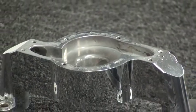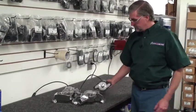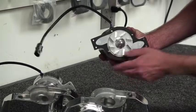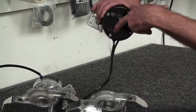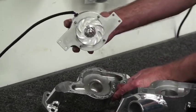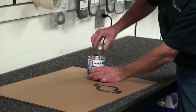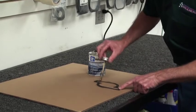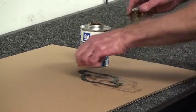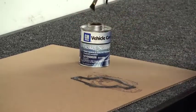Now we're ready to prep a gasket to reinstall the center section. Before we put the pump back together, we wanted to explain the differences between the high flow and standard flow versions. On a high flow pump, there's a larger impeller cavity, so there are only two assembly screws that go into the body — the other two go through the magnet housing into the front plate only. On the standard flow, all four screws go into the body. We use a GM gasket sealing compound — it comes with an applicator. Lightly tack on some gasket sealing compound all the way around, then flip it over to get both sides. If you can let this sit for about an hour, it works a lot better as it has a chance to soak into the gasket material.